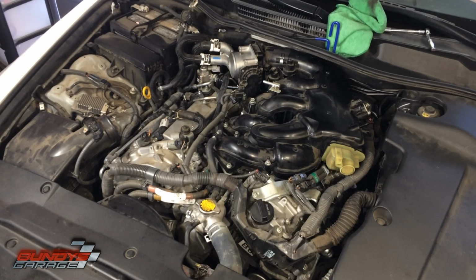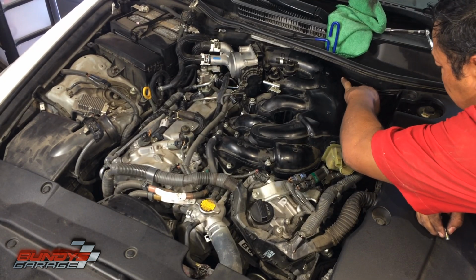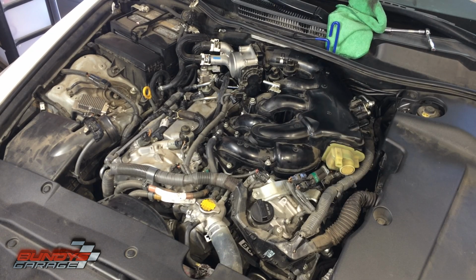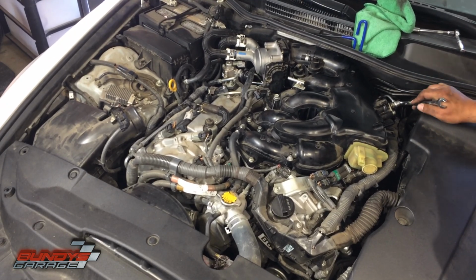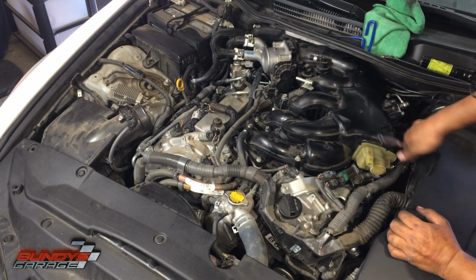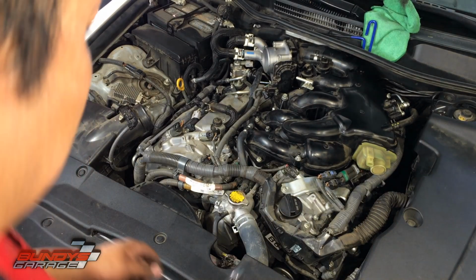Okay, put the connector in first. Connector is in. Bring in the fuel line. Snug that down. 12mm wrench. Okay. I'm going to get this side bolt right here. Now I'll tighten down all the intake bolts. I'll stagger them when I do them.